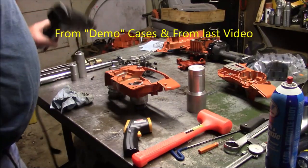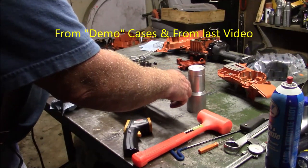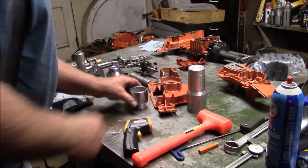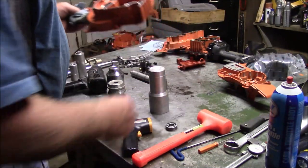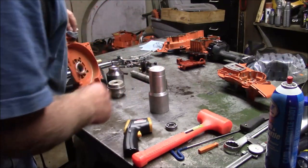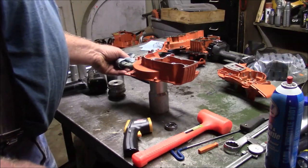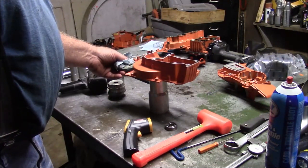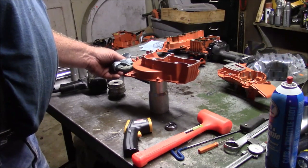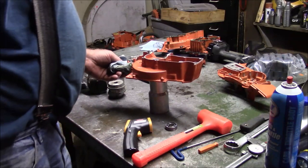Just dropped out. I don't know if you noticed, but I got it up a little bit more than 300 degrees this time. Bearing just fell right out of it. And again, the anvil that I use has just got to be the same diameter as that. And again, if you have the temperature up, it's just a matter of setting it in there, maybe a little tap, but it shouldn't be an interference enough to matter. It should just drop right in if you have enough temperature.